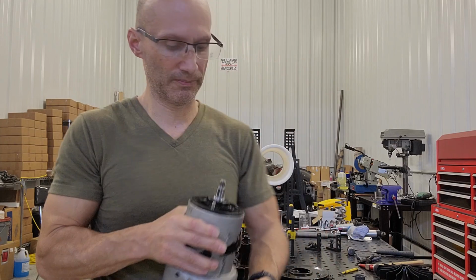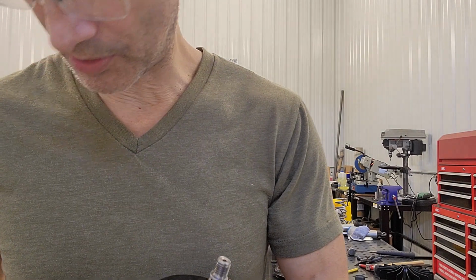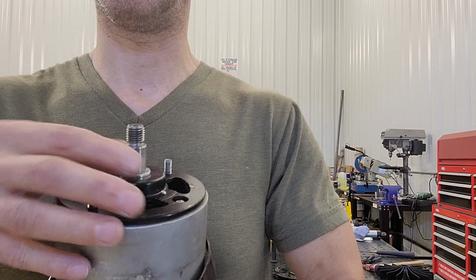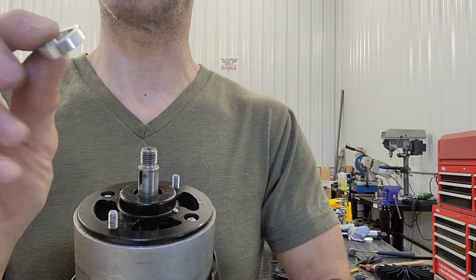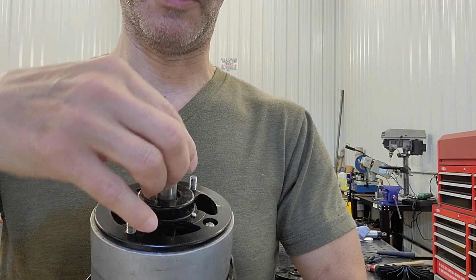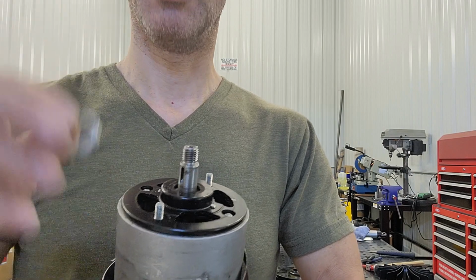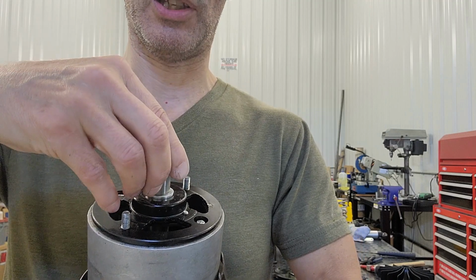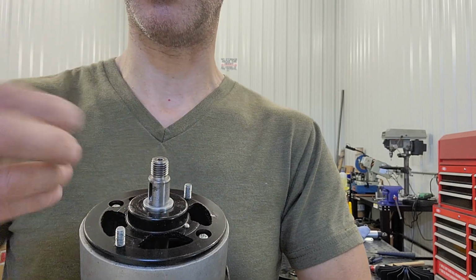On the alternator, I'm going to take this woodruff key out here. Take that out. On the alternator, maybe I'll see this right here. There's this little aluminum spacer right here. See if I can pull it out. No, this is actually one that I made, but for various reasons in prototyping, these vary in height substantially. So these spacers will sit here like this if necessary to space the fan away from the backing plate so you don't have the fan rubbing on the backing plate. So that's what those are for.